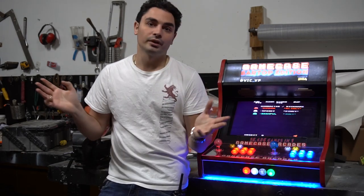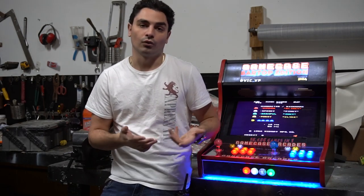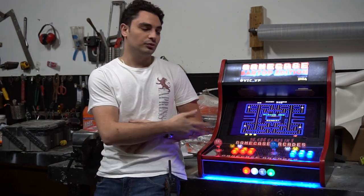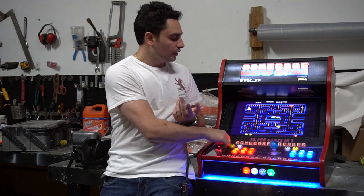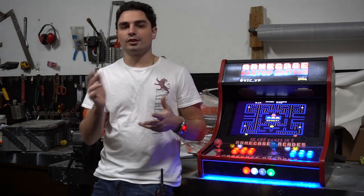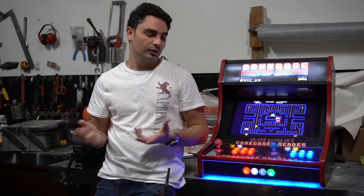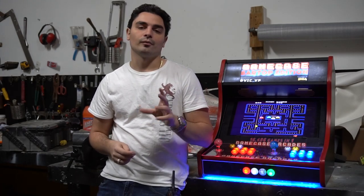There's actually a plate underneath the joystick that you could flip — it's a quick clip-on plate — and it can make your Pac-Man experience much better. That's the only game that really needs four-way. Galaga is only two-way, so no matter what, it's only left and right. Pac-Man is the one people mostly get upset about because they go right, then go left, and it didn't register. That's because with an eight-way joystick, if you're holding right and want to go up, you have to let go of the right and then go up. That's why an eight-way joystick does not play well with four-way joystick games — most commonly, Pac-Man.